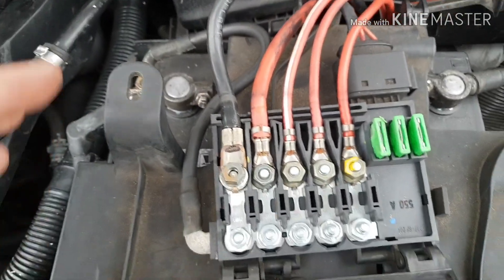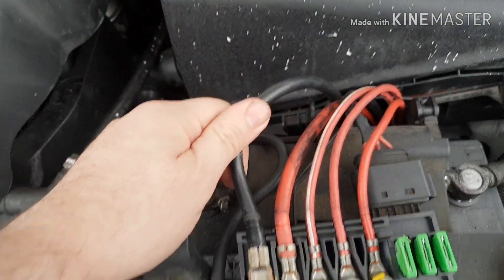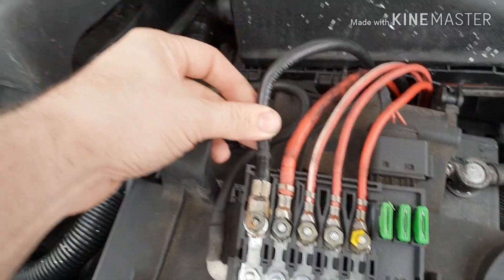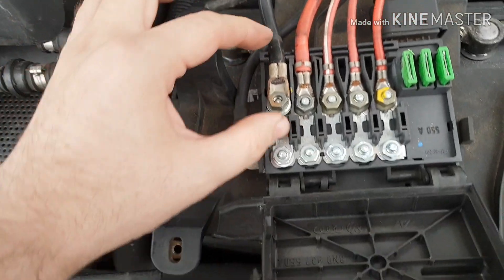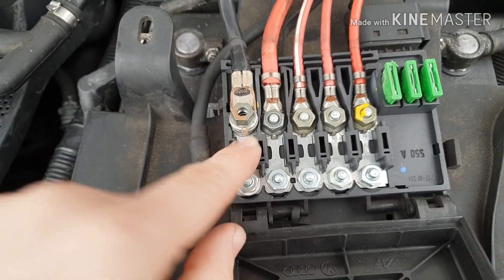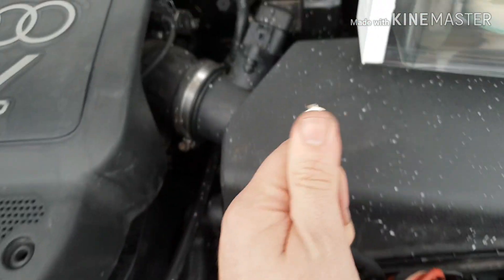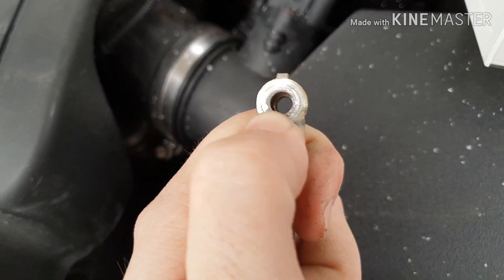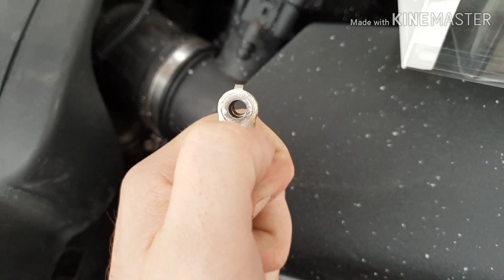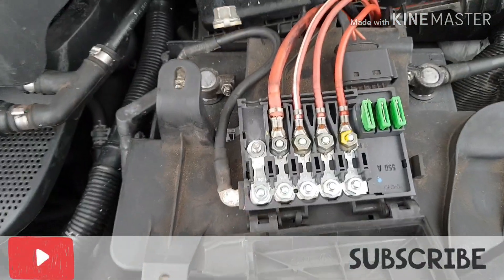I know a lot of people have been saying this isn't a thick enough gauge cable, but it is — there are lots of cars out there that haven't got the issue. It's just that over time, maybe a little bit of water ingress or movement has allowed it to arc and cause the contact to char up. So just clean it up and you'll be good to go.